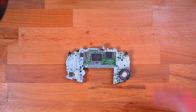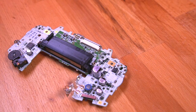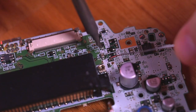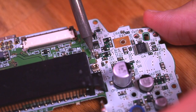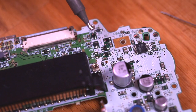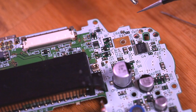Since I already have the motherboard removed from the GBA, we're going to go ahead and prep it. We'll need to remove capacitor C54. To do that, add some fresh solder to both sides, and then with the tip of your iron, heat both sides at the same time to remove it. Be careful not to accidentally remove the small resistor right next to it during this step. Do take note: if you have a 32-pin model motherboard, you do not need to worry about this step.